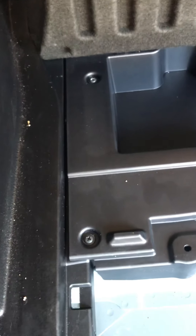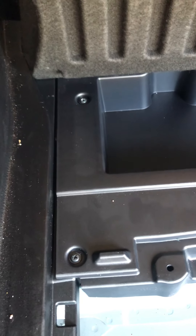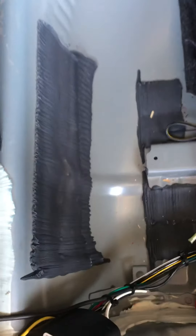From there, the rest of this car is just snapped together. Run it down here, unsnap this panel, push the wire down under through here, pop this panel up and feed it. The toughest part was back through here past the seat. I fed it as far as I could underneath the panel — you can get your fingers under there and feed it up. When you get back here it got a little goofy, but when you lift this up there's an additional storage area: take these two Phillips screws out and it pops up, giving you a ton of room to fish the wire back through.